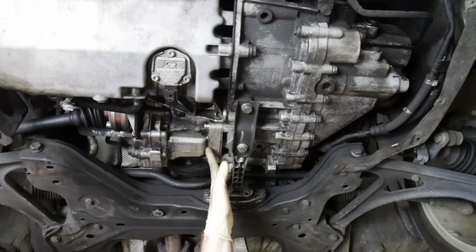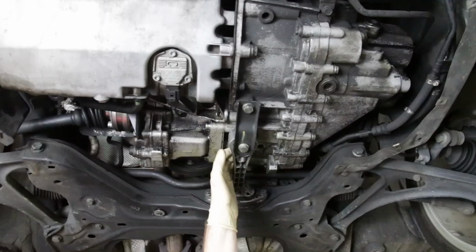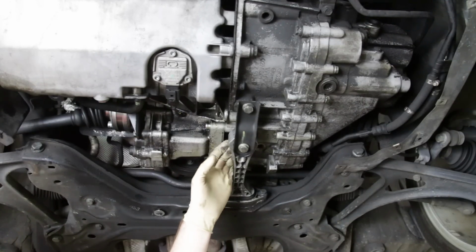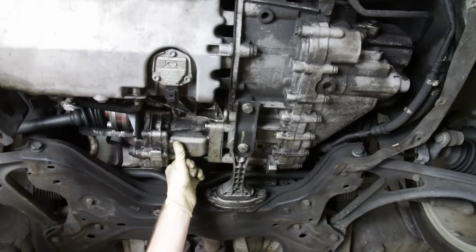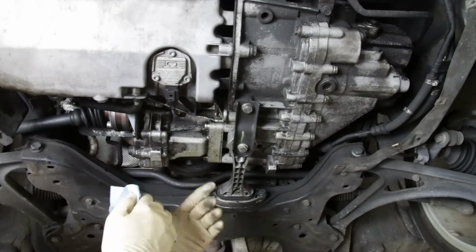Okay, so as we look under an engine, you're going to need to look around and determine if you have anything that's out of place. Now, most notably on this engine, I don't see too much out of place, with the exception of the fact that if you take a look here, you see this griminess here? This griminess is not normal. I know a lot of people think that engines are supposed to be dirty. This is a result of a leak of some kind.